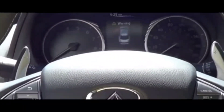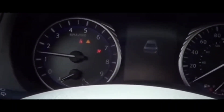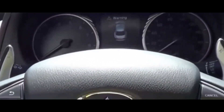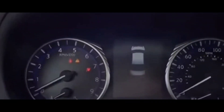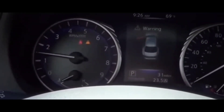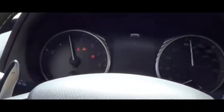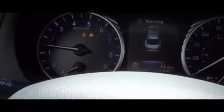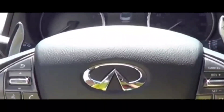Also, the PSI on your tire pressure can change ranges if it gets colder or warmer out. If you have an LCD screen or access to the TPMS PSI readings for each tire on your dash, you'll notice that tire pressure changes depending on temperature. If it's colder in the morning, that PSI will go up or down depending on how hot or cold it is outside — temperature really does affect the TPMS readings.